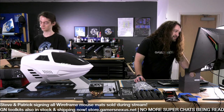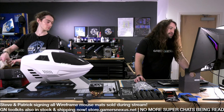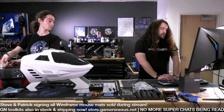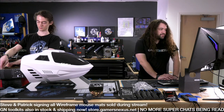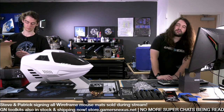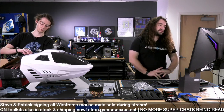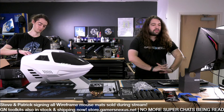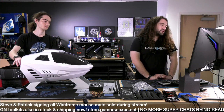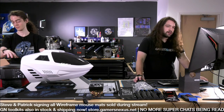Shinryu Kid says, is it worth upgrading from a 3600 to a 5600X since I have a 3070? I'm using an Asus Prime B550 board. It would give you a bit more performance in 1080p gaming. If you're playing at like 4K or 1440p, the uplift would not be substantial. So personally, I wouldn't upgrade from a 3600 to a 5600X. It is a good jump, but I think waiting a generation here is worthwhile.